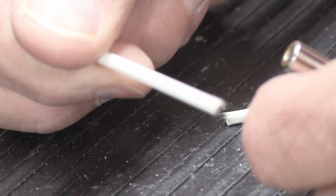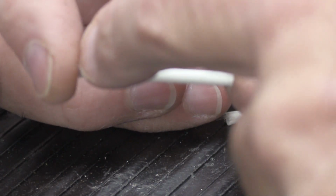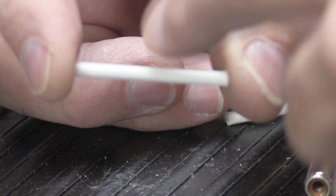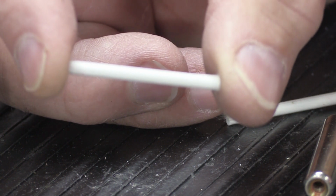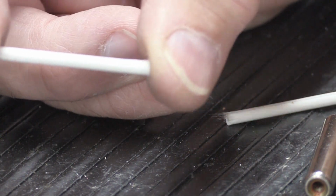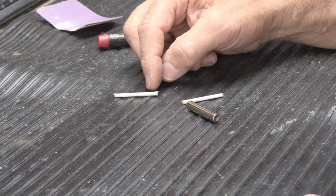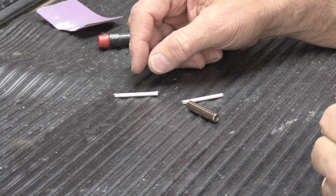So I like the fiberglass tip material, and you'll notice, I showed you before, this is actually very long. This piece right here is 1.25 inches long because that's the size that we cut the fiberglass rod into, so I have it ready to go when I need it, and that's the starting point for making new tips inside any NuTone plunger. When we make replacement tips, we do it different than NuTone. I think my way is better.